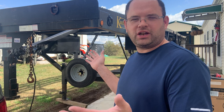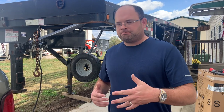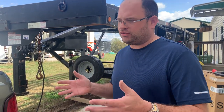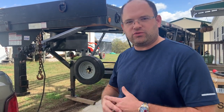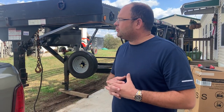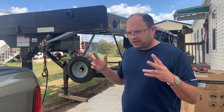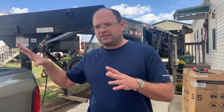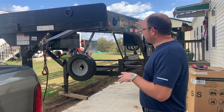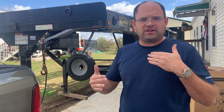I was thinking: is it the truck's fault or the trailer's fault? I got my multimeter out and did some troubleshooting — truck's fine, trailer's fine. Well there's got to be an issue. Bottom line is the controller in the truck... I use this truck all the time to pull my gooseneck two-car hauler which has regular electric brakes. What I found through troubleshooting is there's no resistance with electric over hydraulic brakes — no resistance — so the truck doesn't know anything's back there. We've got to give it some resistance.